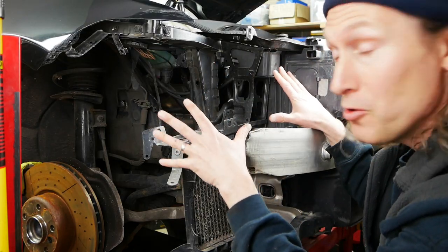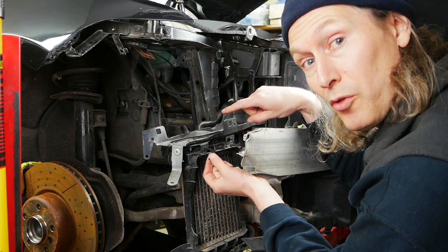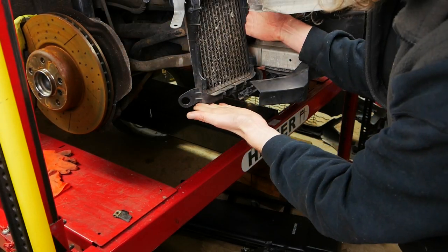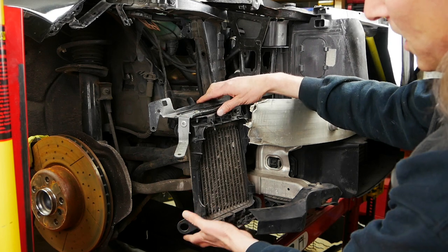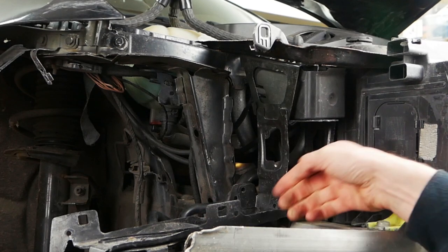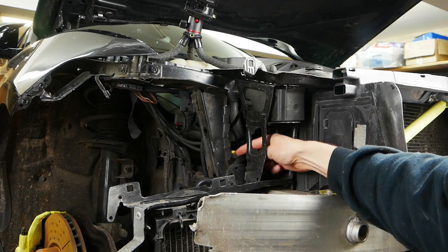Now with the headlight out I have an even better view behind here, and there's more evidence that the owner of this BMW crashed it before. One of the clues is there are tie wraps here that have been used to hold things together - there's one at the top and another one down at the bottom as well. The position of this whole thing - I'm not 100% sure it's correct because I think it might be slightly bent or maybe needs adjustment. In fact, here's an even better clue that this bracket isn't quite where it should be, because this is bent. If I straighten that up it would probably move all of this part of the bracket down a bit, so we'll get that sorted.